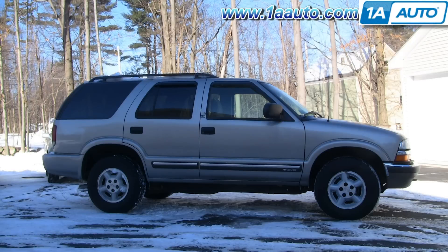In this video I'm going to show you how to replace the plug wires on this S10 Blazer. I'm not going to show you how to replace each one individually, but I am going to show you the techniques to get to them and the principle behind how you replace them and what order you go in. For tools you're just going to need a screwdriver, because you do have to take apart the intake assembly, and you'll need a pair of needle nose pliers, or if you have them, spark plug boot pliers.